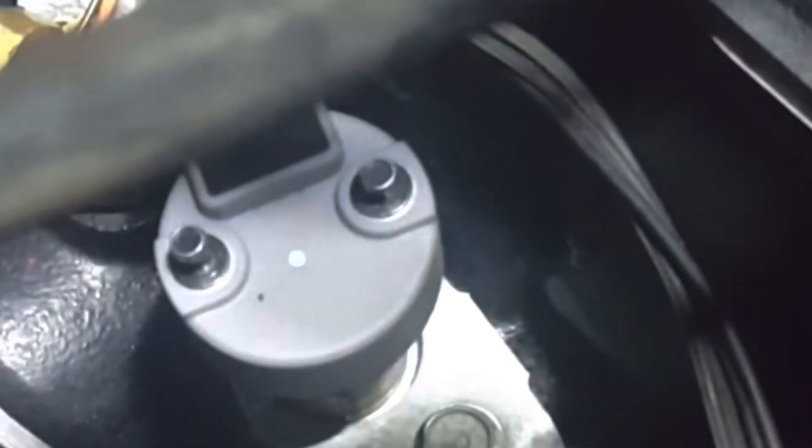One thing I want to mention before we get into the rest of the video — putting stuff on and then starting it up — I wanted to go over the cam sensor. I want to warn you guys before you do this because I had a challenge starting my Cherokee. I ended up tearing the whole front end back off, checking the timing chain, making sure it was still in time, on the right stroke, top dead center with the first piston. It was fine, but I couldn't get it to start because I'm used to working on older stuff that has a distributor. If you have a newer Jeep, it has a cam sensor instead of a distributor. My original timing chain was pretty loose, honestly.